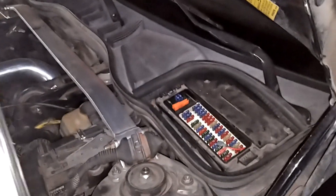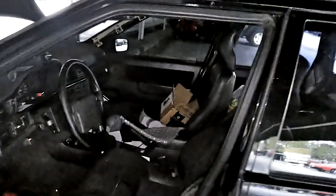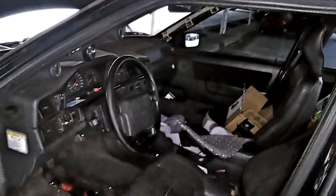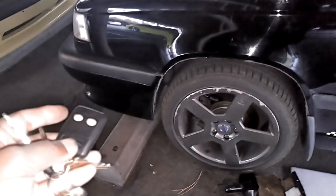I'm going to try to reprogram my remote — maybe some glitch in the wiring caused my remote to become unprogrammed. It's very rare that you can't lock or unlock the door with your remote; usually one of the features quits, not both. My battery's testing good. Couldn't find any other fuse. Still not sure what's going on with the remote on Panther — fuses are good, the alarm works, I just can't get the keyless entry system to work. I even swapped the relay from Queen B to Panther. My next test is going to be to replace the remote.